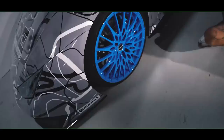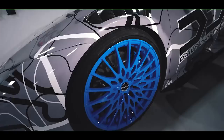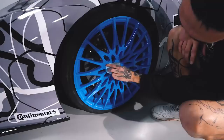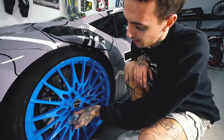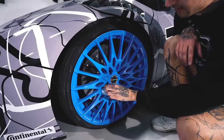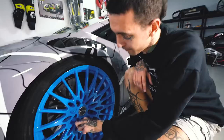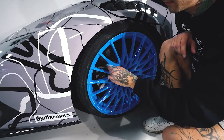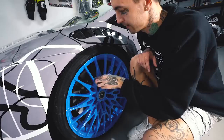For the wheels, it's a different product — the top coat for the paint. What's the method? On the rim, you start with a valve and work your way around like a clock, basically wiping the entire surface a couple of times. It's bonding immediately — once it's on, it just starts to bond and then it starts to cure. So once it's on, it's on.